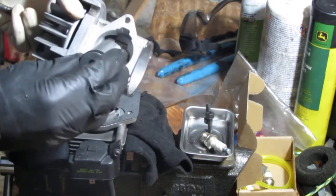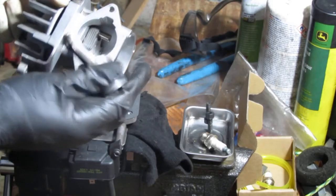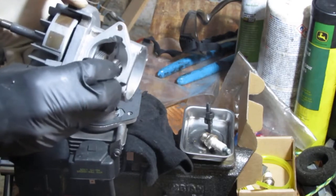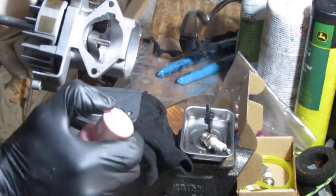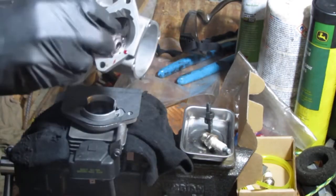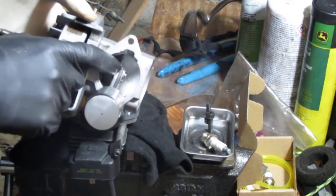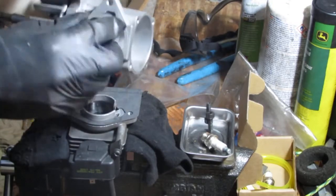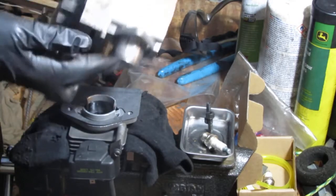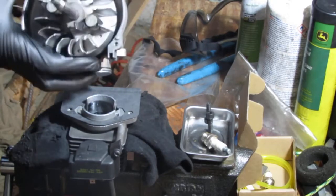The piston could go either way — there was nothing unique I saw. Let's take the piston and slide it onto here like that. I should probably put a little bit of assembly lube on this here. So I just put some assembly lube right here. I'm going to rehearse this real quick so I don't get too screwed over — it's going to go like that because the magneto is there.